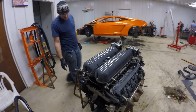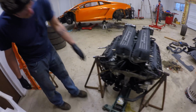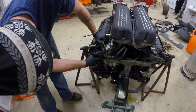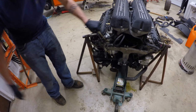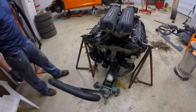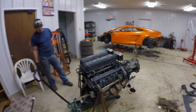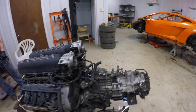You said we could pretty much change coil packs, if we got them wet, and magically damage nothing else. That's about it. Even this coolant leak that was out of this pipe here, you have to pull the motor to change that gasket. So if something like this were to happen again, it'd be another 20 hours of engine removal. So there's just no access. No, everything's real tight in there.